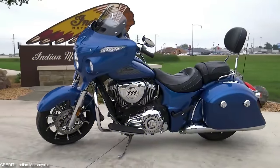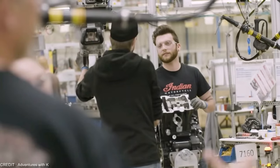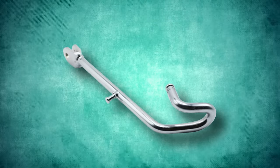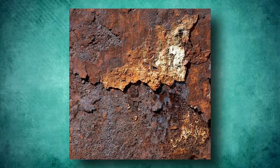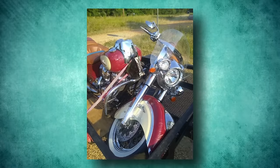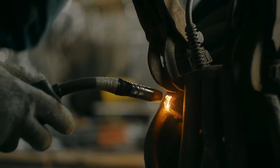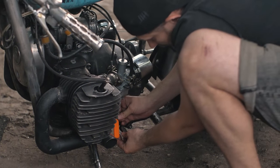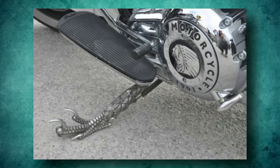Although some Polaris Indian owners have reported that their bike stands have only cracked and peeled in the first year — 2014 — others have said that the issue has occurred on bikes as recently as 2017. Polaris' in-house professional engineering team designed all the components in the early Indians, but production was contracted out to mass manufacturing facilities. The chrome finish on some versions of motorbike side stands would chip and finally peel off in big pieces, exposing the raw metal underneath. Eventually the rust and decay will completely consume the peeling stands. Earlier models of Indian bikes were rumored to have a problem with the side stand hinge cracking on a chronic basis as the stand was raised and lowered. Some bikers choose to repair their broken side stands with welds and re-chrome their kickstands, while others opt for a newer, more sturdy Indian design or an aftermarket replacement made specifically for their model year.